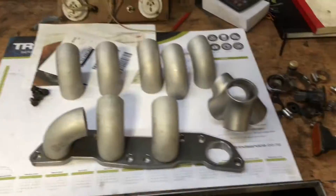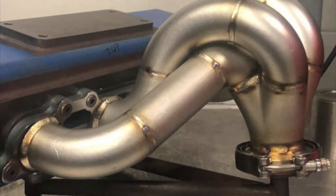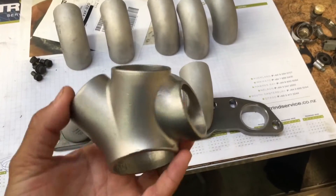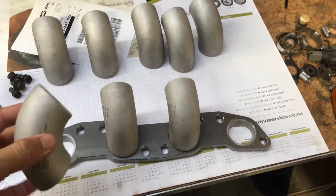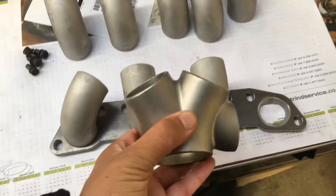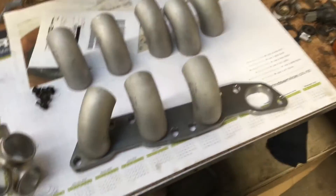What I'm planning on making is some manifolds for the turbo one. The Synco manifold came out real cheap, and I bought this from Hypertune when I got the manifold. Just these pipe bends, and this stainless steel tube from Steel & Tube. So I'm going to make a low mount V-band manifold just for the SR20VE, just because I've always wanted to make one.